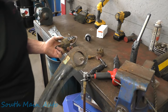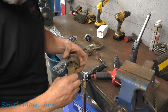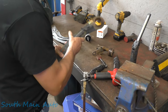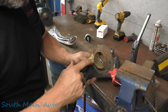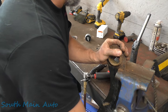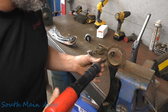I'm going to show you real quick how to pop in a new bushing — it's not too difficult a job. We've already done one; I've done a couple sets of these in the past. If the bushing doesn't just pull out by hand, lock it in your vise and push the arm up and around and it pops right out — that's what I did with this one. You're still left with the metal sleeve, so either take a cutoff wheel, use an air hammer like we're going to, or take a torch and just slit it. We'll clamp it in the vise and use the inside/outside cutter for the air hammer.